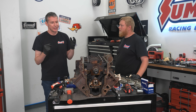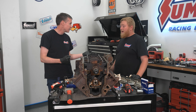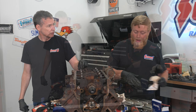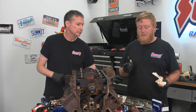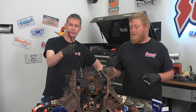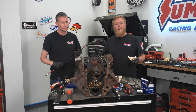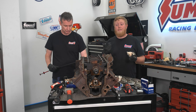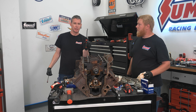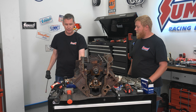Cam bearings are not that hard. Two people - what did it take us, 40 minutes? We rolled right through them. We installed them all from the front of the engine. I marked them to index the oil hole so I could visually see where it needed to be. Then I used my Sun-X four-finger grabber, dropped the bearing down in there, maneuvered them around, and put them on the tool. We used the clock method - counterclockwise or clockwise to get the oil hole lined up, then sent them home. Then you use a pick to make sure the oil hole in the bearing goes down inside the block - just a nice check to confirm it's going to feed your bearing.